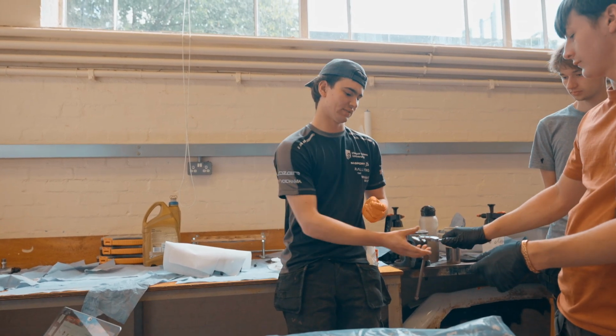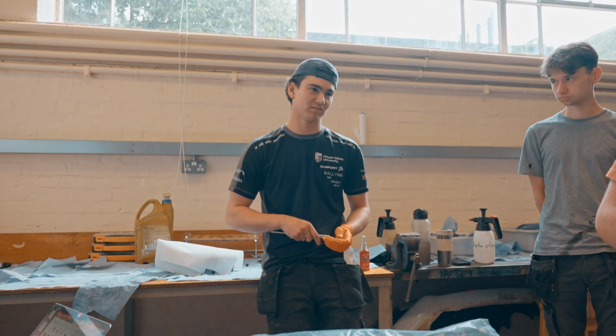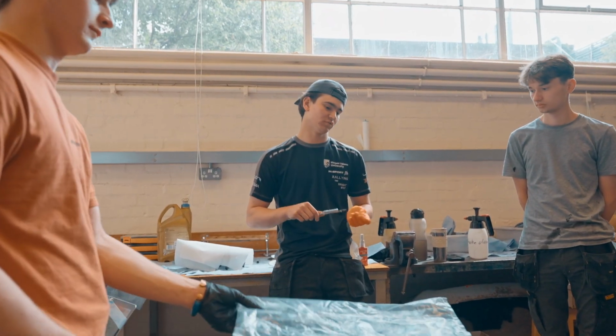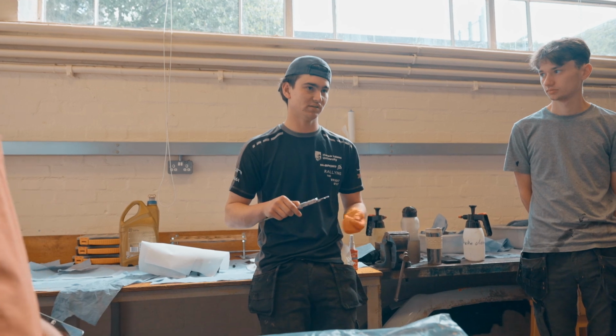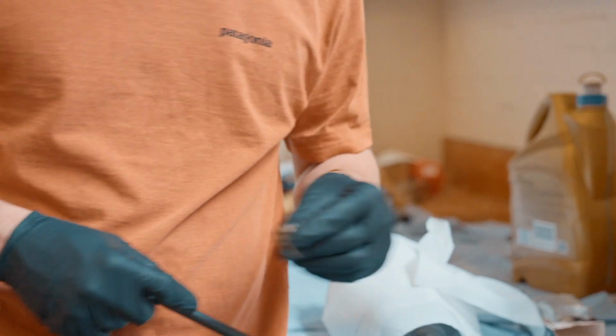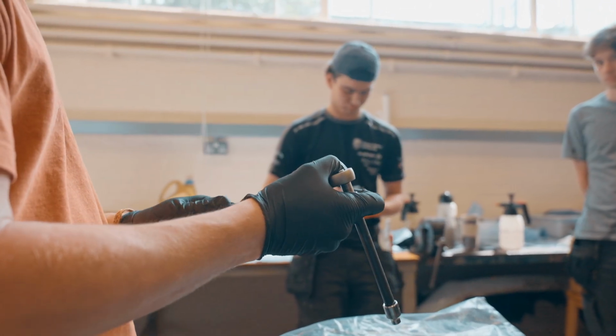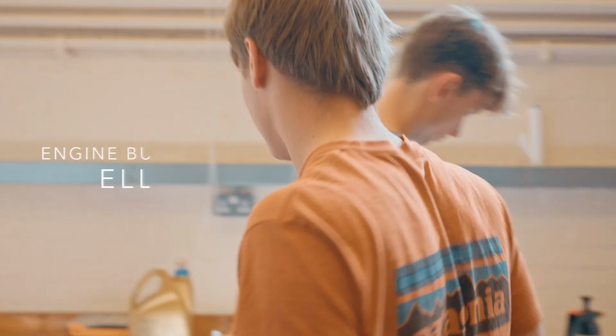If it's steel to alley, you often take around 10% or so off, just because the alley's softer. It's still in steel, you don't need to. 2, 4, 3 on the threads. So I'd probably say a safe torque is 10. Yeah, 10. Yeah, me too.